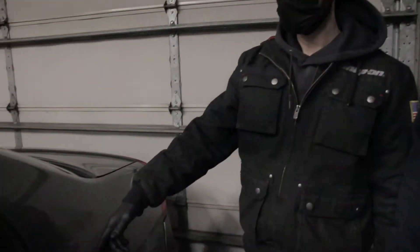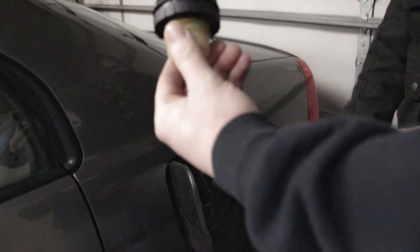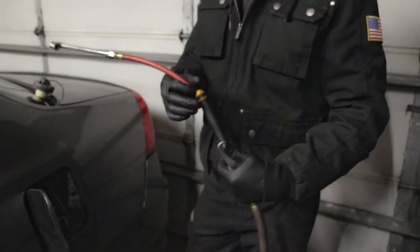First thing you want to do is pop your fuel door open, get your cap out of there, take our cap and screw it on — it's not gonna click, so you're just gonna have to get it all the way down. Nick's gonna pressurize it with only five to seven PSI. Anything more than that could blow some stuff up. We got it in — that's precisely five to seven. It didn't even move the plunger. It starts at 20.